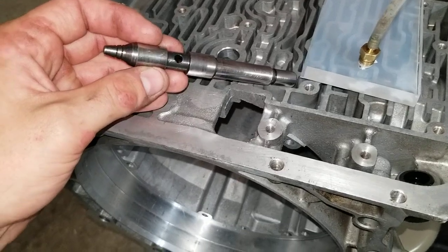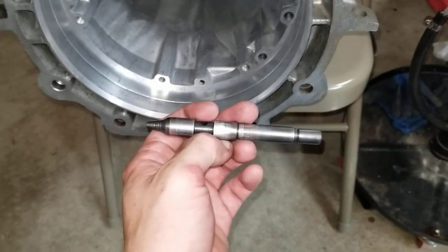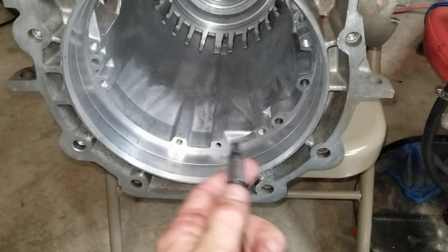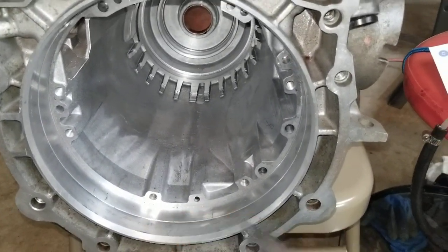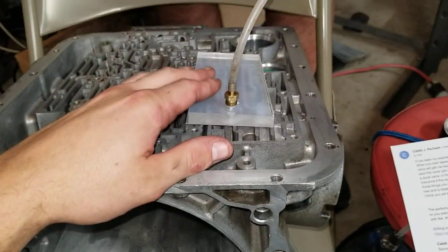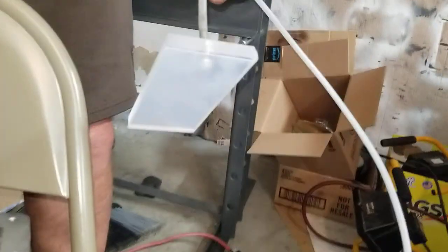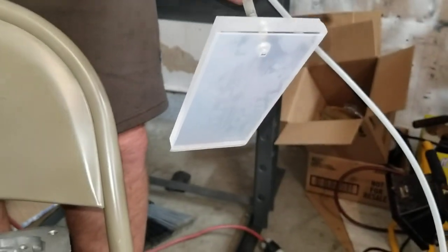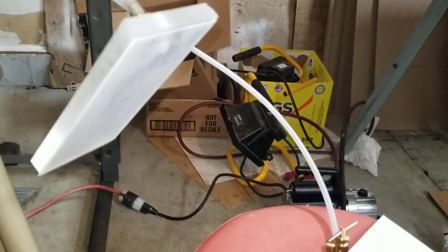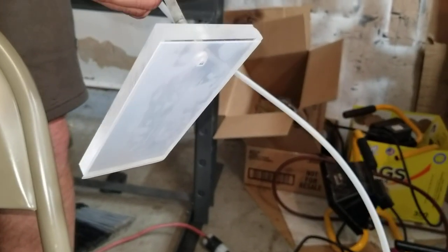In the 20 range, you have to take into consideration warpage of the valve body as you bolt it down — with a tight tolerance, if this bore flexes a little bit, it could cause a sticky valve or even a completely stuck one. Vacuum testing is one of those things you learn over time and experience. This had me concerned when I wet tested these because there was a drastic difference, and now I'm questioning whether the old case was actually one of my issues prior to the explosion, causing some shifting issues. The testing block we used is clear plastic and some clear rubber I found on eBay — it worked out well. I'll try to post links in the description.